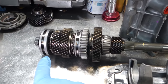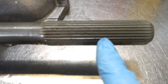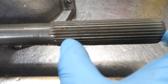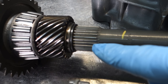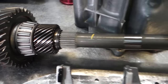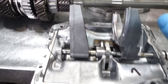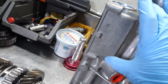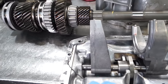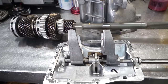These are the essential components of the standard Mustang five-speed: the long extension housing and the main shaft with all the gears on it. This is a 28-spline main shaft, meaning it has 28 splines where the rear yoke goes in as well as where the fifth speed gear splines onto it. You can see the overall length of the main shaft, and since the shifter is on the very end of the extension, you're going to have to have a longer shift rod.